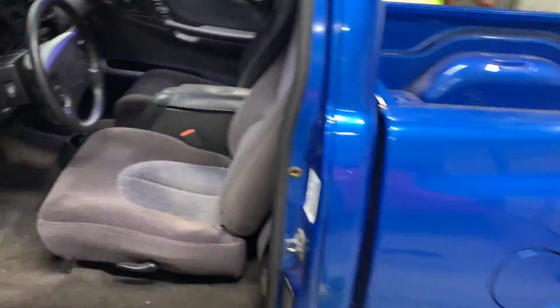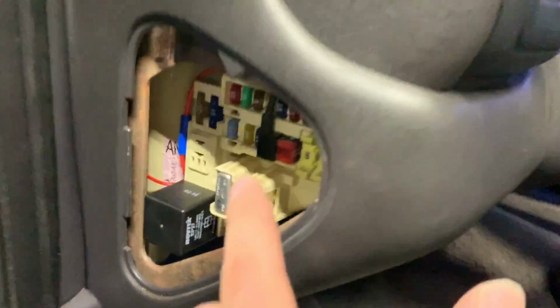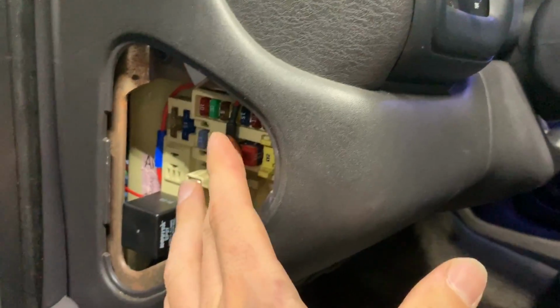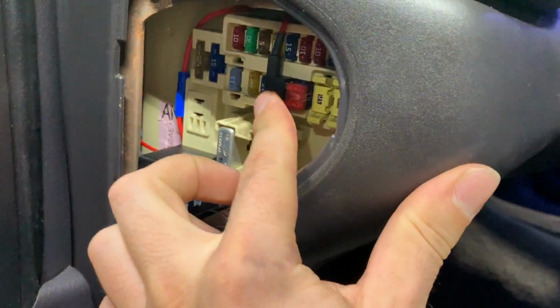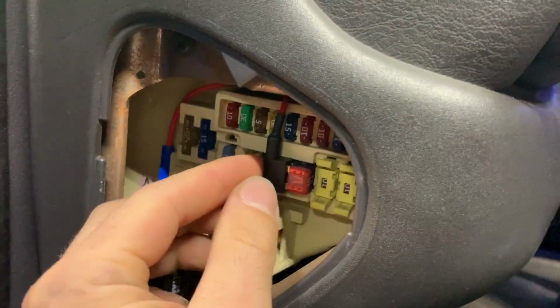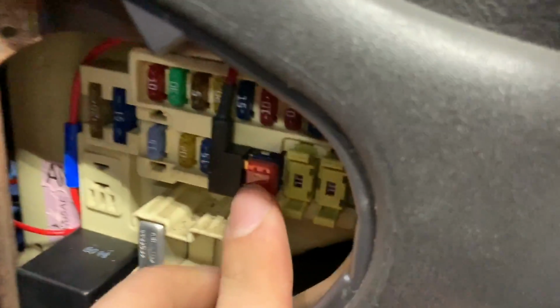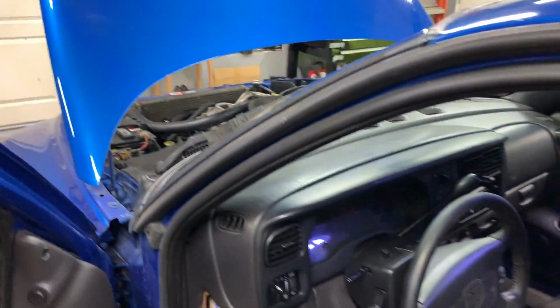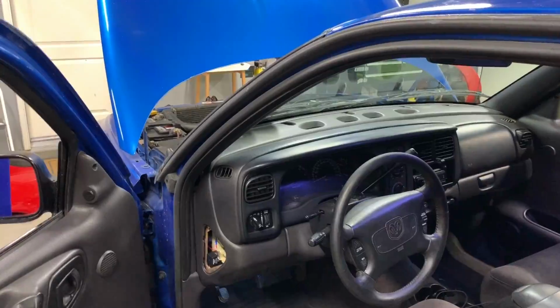So what we did instead was we just went to in here. I got one of these fuse taps off a true switched ignition power. This is just off the cigarette lighter. It's one of these fuse taps. I'll link in the description below. You can grab one, you remove the fuse, put this in, it holds 2 fuses, so you still have a fused power. So this is running to our switched ignition on our relay. Now we shouldn't have any issues or anything interfering with anything.